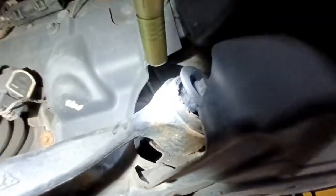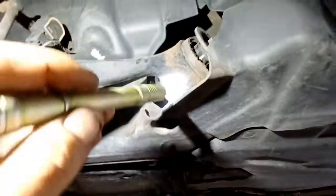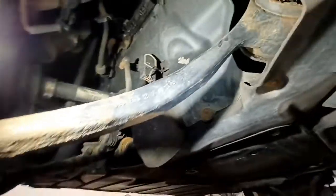This one's super obvious — this is an extreme case. You can see the rubber is just completely torn out of this thing, so it goes wherever you push it and the whole thing is moving. What you're seeing is this arm is just bouncing from one side to the other, and that's the biggest issue here.